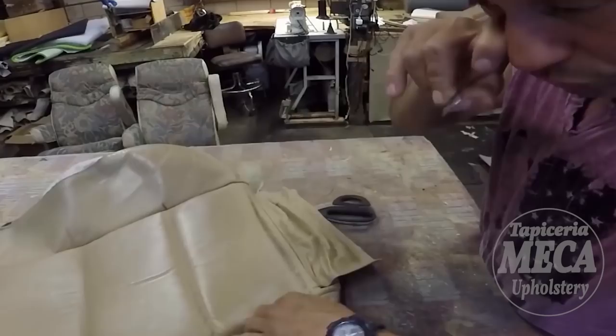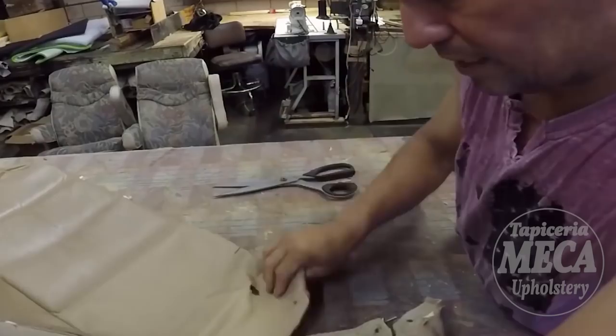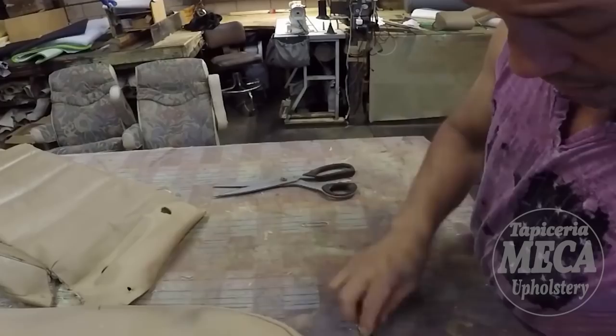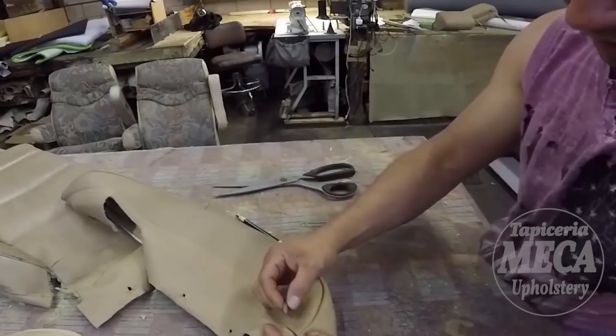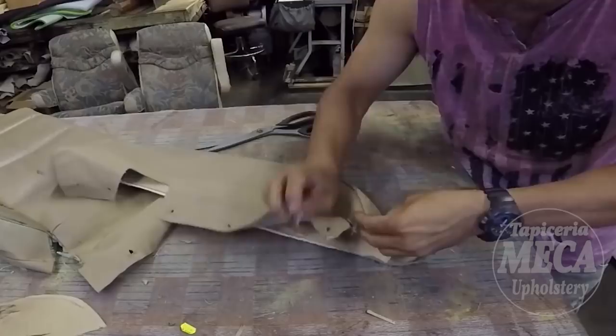I know there are a lot of experts subscribing to my channel. If you are one of those who are watching this video, you know the centerpiece, it is not necessary to unstitch it. You can just measure it by the side of the foam and cut it by the foam. It is easier that way. But I am doing this way for those who have never done a seat like this.